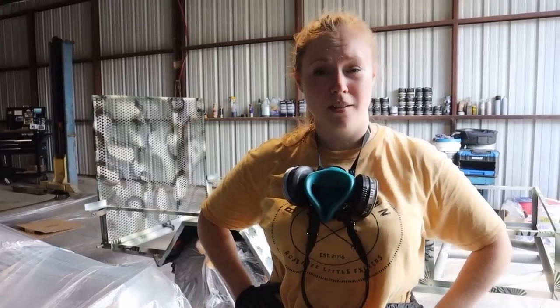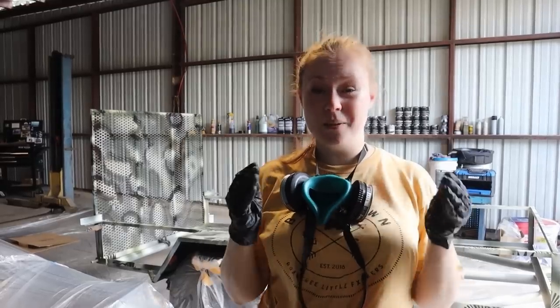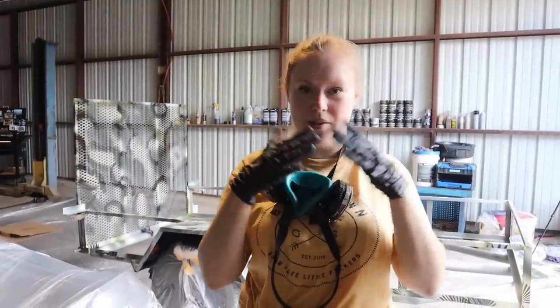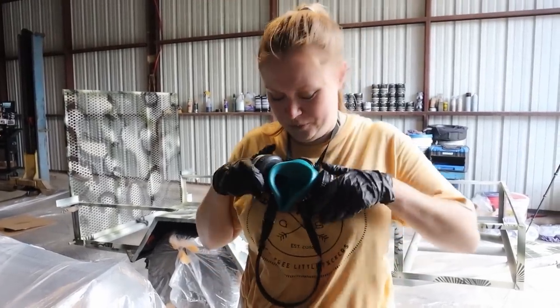Is there anything the average person getting ready to paint something like this should know about clear coat, to the point where you wanted to be with me today and help me out? You usually use a hardener, and the hardener contains isocyanates, which attach to anything that has moisture. So I really want to stress a lot of PPE. Nostrils, eyeballs, ear holes, mouth, everything. Cover everything up because it will attach to that, and you also don't want to get it in your lungs.